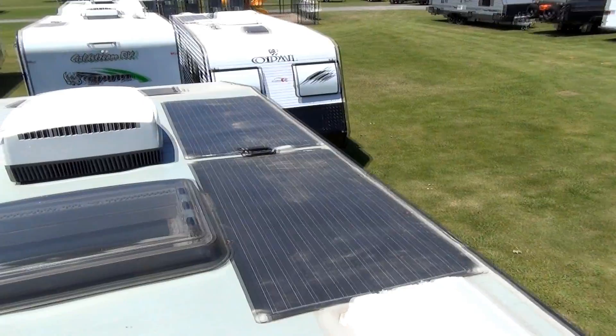Just using 12 volt appliances, which is generally what you use in a caravan when you're in remote areas, the system will rarely get down below 30% discharged. With the sun out and 480 watts of solar on the roof, this battery system pretty much stays at 100%. You've got 20 amps of power sitting on the roof trying to get into a 100% charged battery — you've got to use that 20 amps first before the battery will even start discharging. You can run all your 12 volt appliances and the battery will just remain at 100%, until you turn something on that runs off 240 volt.